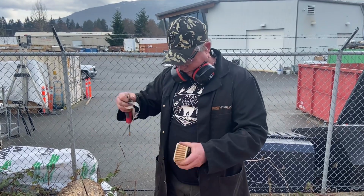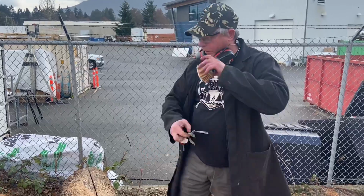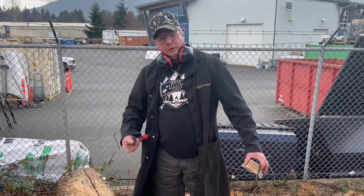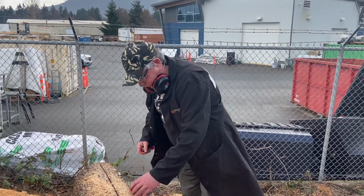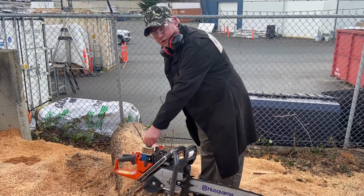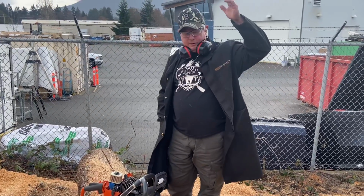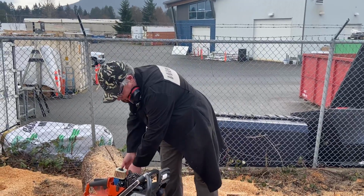So the way to do it is you warm the saw up, and I'm going to do a long rip in this wood here, wide open throttle, and try to get it to run around 9,000, 10,000 RPM. So let's put this on, and you're going to hear this thing change in the RPM. As it's going, you'll hear it wind right up, and it'll go down again, then it'll wind back up again and come back to life.